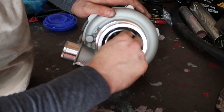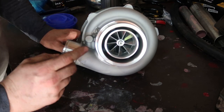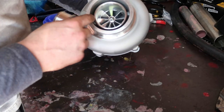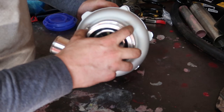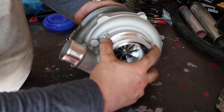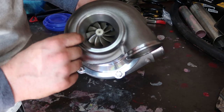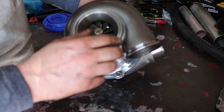Silky smooth. This is the first ball bearing turbo I've ever had — the first one. And the casting looks real nice, real nice and tight. No deformities or anything like that. You can see by the untreated cast that it's a nice high quality casting. This is tapered — and a lot of eBay turbos you get, these are just left square, they don't even bother tapering them.